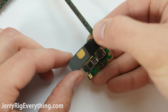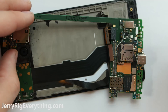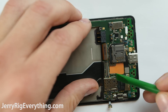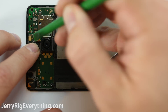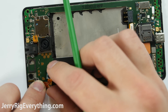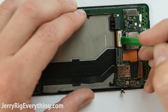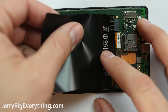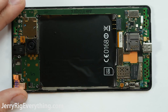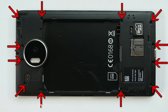I'm going to reattach the rear camera and that one small ribbon cable on the back of the motherboard, then set the motherboard down into place, pressing it down into the series of clasps around the outside. Here's the headphone jack — clip that down into place, you'll feel it snap like a little Lego. Here's the 5 megapixel front camera — clip that in first, then fold it over the top and press it down into the frame. Clip the screen ribbon cables down into place as well, and the small ribbon cable along the side of the board next to the vibrator motor. Then the sticker goes back into place over those ribbon cables, then the back panel along with those 12 Torx screws, battery goes into place, and the back cover.